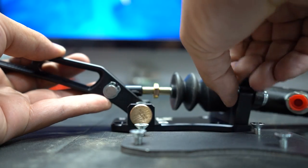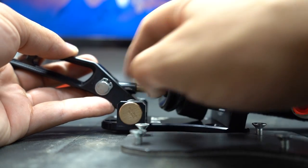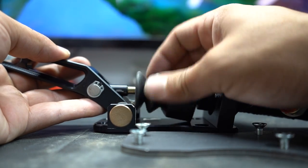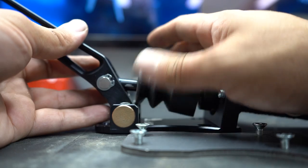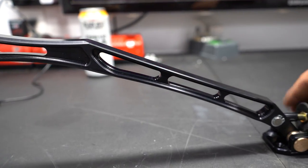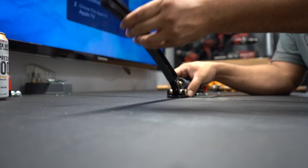Pop this sleeve forward. You're going to be limited in how far you can screw this up because of the length of the rod and the depth of the heim — but don't forget, grinders exist. You can just cut the rod, essentially shortening this shaft, and then the handbrake can stand up a little bit higher. I feel like you can get plenty of adjustment out of it, but if it's mounted in a super awkward position you can still cut it and make it higher. I really like this setup and huge kudos to the boys for making it a flippable system.